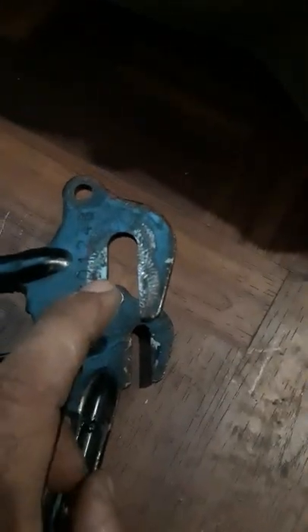Every bike from the 1940s used this design — this is a post-war design. Pre-war Schwinn's, before World War II, had a different design. This hole right here for the chain guard tab is how you tell it's post-war. Pre-war bikes don't have this tab — that's the cutoff. After the war they added this tab for the chain guard on every single bike. Before the war the chain guard clamped onto the frame itself; there were no holes for it.